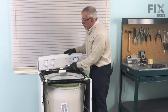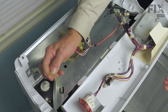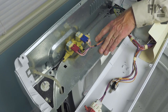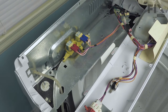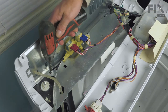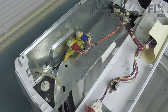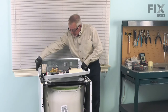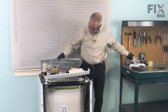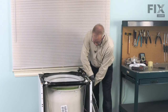Now before we go any further, we'll remove the control panel and the back panel here to get those out of the way. Just pull the air pressure dome tube off of the pressure switch. Next, we're going to remove four screws that secure the mounting bracket for the water valve and water inlet, which also holds the back panel in place and the end caps. You may also wish to remove the ground screw — that will allow us a little more movement with the wire harness. The end caps are attached to this back panel; you can just tilt those forward and lift them off. Just set those aside.